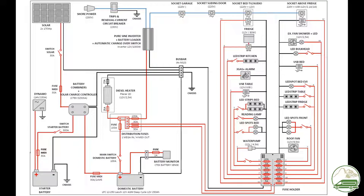So now we are going to take a look at our electrical design. The main feature of the electrical design is that we want to be able to be off grid for about 2 to 4 days. As our main appliances we have to run a fridge, a roof fan, a diesel heater, USB chargers, a water pump and our lights. All these appliances run on a 12 volt DC system.